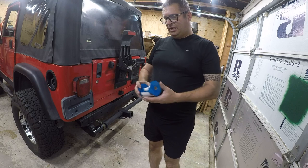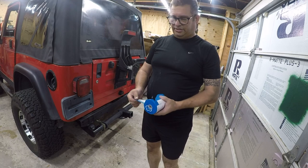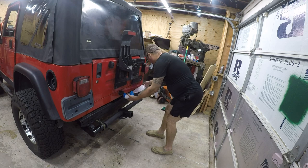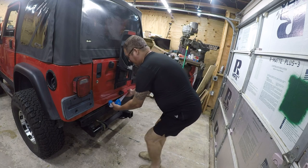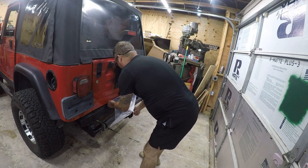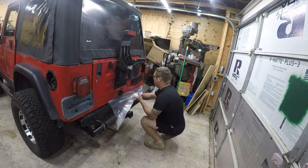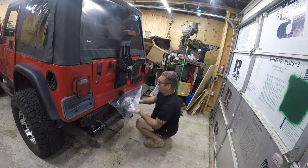It'll be here tomorrow. I'm using some Scotch Easy Mask. That's what I call it. I don't know what they call it. Anyway, you pull it out, it has the tape built in and already attached to the plastic, and this is great because it speeds up the masking process. And Murphy's Law is you will run out partway through the project. So you always want to go back and hand adhere the plastic.